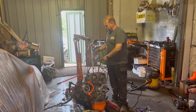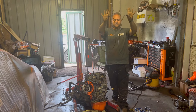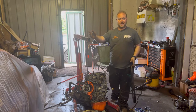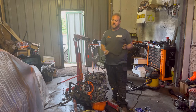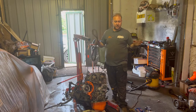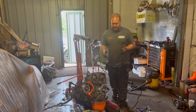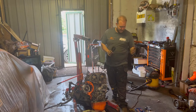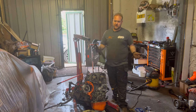Here is my new timing belt, and here is my old timing belt. As you can see, the new timing belt is considerably shorter. So I went on to my eBay purchase history to look at exactly what I ordered, and stupidly I have ordered a 3S-FE engine timing belt kit, not a 3S-GE which this engine is. I'd obviously just seen the '3S' and hit buy without actually doing any digging. I also think the water pump is going to be an issue as well, because I've counted the teeth on the one I've just installed and it's 22 teeth on that pulley, whereas on the original water pump it is 23 teeth. So the belt being shorter with less teeth is going to cause an issue.